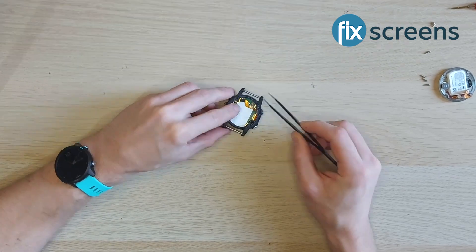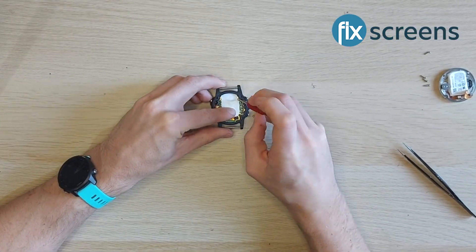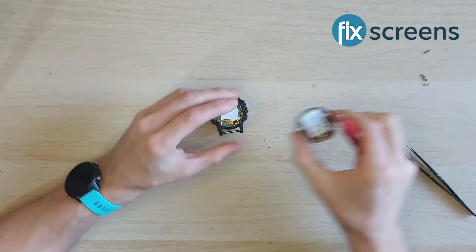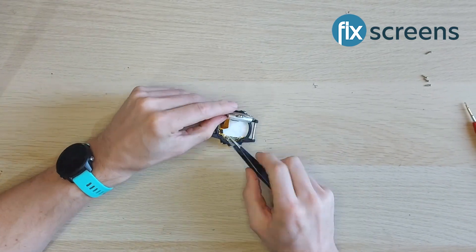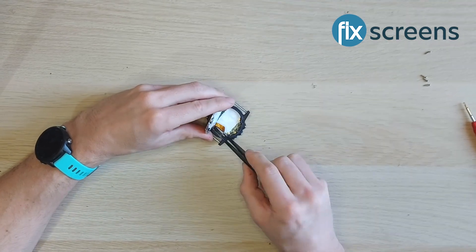When the board is now in place you can attach it into its connector. If you have the device positioned so that the two ribbon connectors are at the top of the device, this second ribbon goes into the connector that's on the left-hand side. You can now reinsert the two screws that secure the board to the top part of the housing.